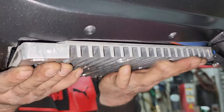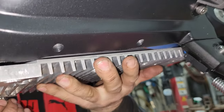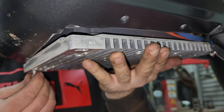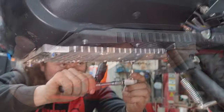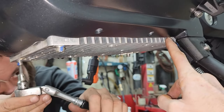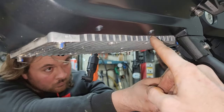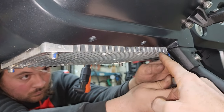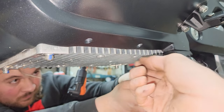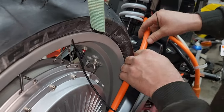This part's proving really tricky — getting this heat sink back up on there. Everything's super tight and pushing back down against it, so we're having to work really hard to get these big cables to lay right and not get any connectors on top pinched up in there. Just take your time with this and be ready to fiddle with it. I would highly advise that you take very careful notes about the routing of those three thick cables on this side of the heat sink. Zip tie the cable back up against the swing arm so it doesn't touch the tire.